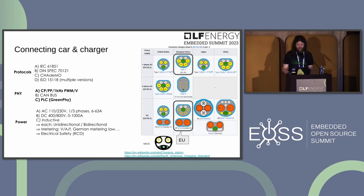For AC charging, almost every charger uses a simple PWM signal to communicate whether the car is plugged in and requesting power, and to encode the current the car can draw from the charging station side. This PWM signal is transmitted over the control pilot wire in the plug. DC charging is more complex — DIN SPEC 70121 is mostly used, while CHAdeMO uses CAN as its signal layer and is mainly used in Asia.